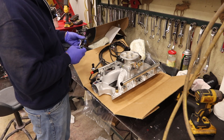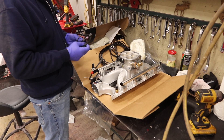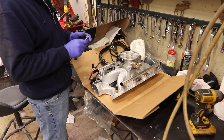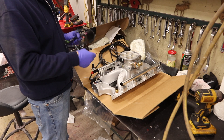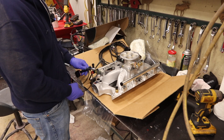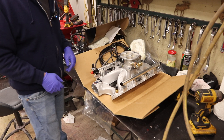There is this other harness — this goes to the distributor, this plugs in, and that's the other plug that goes into that. Idle air control. So this is the front part of it. Positive and negative for the coil, which I'll have to extend because my coil is not up on the manifold.